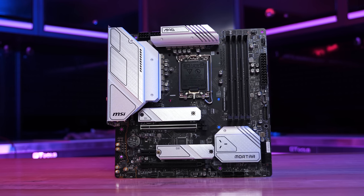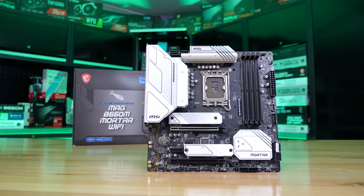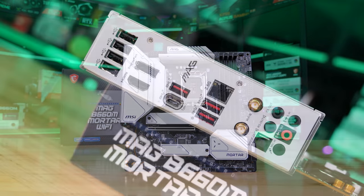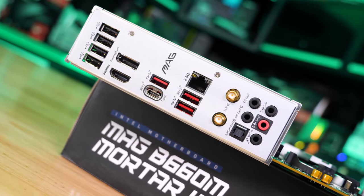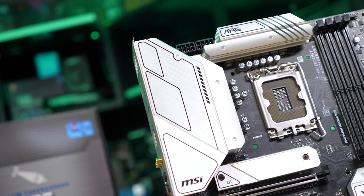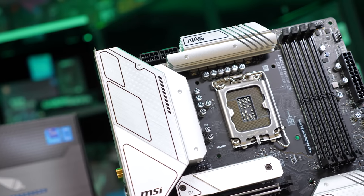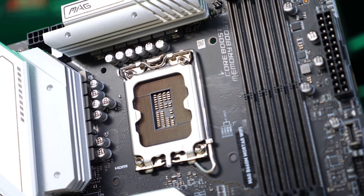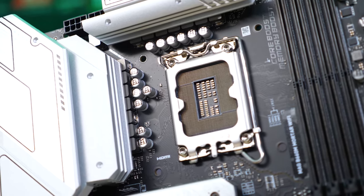This is a Wi-Fi only model so Wi-Fi 6 support is provided out of the box along with 2.5 gigabit LAN and eight USB ports in total, including a USB Type-C. The board is littered with heatsinks — there's a large heatsink over the B660 chip, two M.2 heat spreaders, and two large VRM heatsinks that also extract heat from the inductors. The IO shield comes pre-installed. The VRM packs a six-phase V-core with two Renesas 60 amp power stages per phase, so a dozen 60 amp power stages total, delivering a very high performance VRM that dominated our testing.